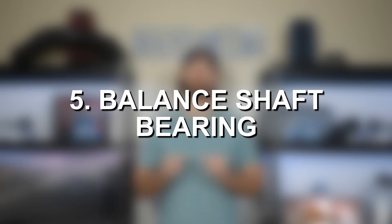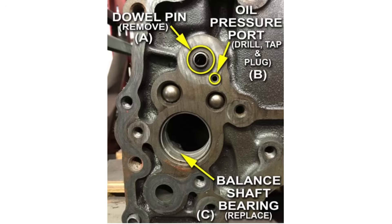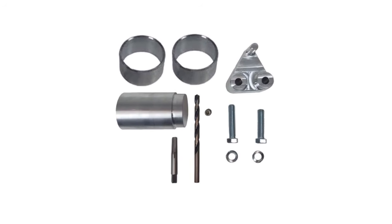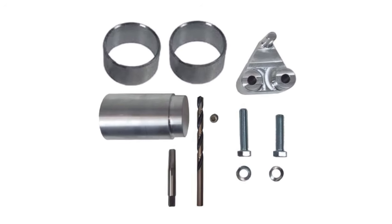As a bonus item, we have balance shaft bearing failure. This is a bonus because it predominantly affected Venezuelan models of the 3RZ-FE sold from 2001 onwards. The 3RZ-FE uses two chain-driven balance shafts to help reduce engine vibration. There was a manufacturing defect with the Venezuelan engines; this didn't affect the U.S. market, but balance shaft bearing issues can still occur. There are companies that sell balance shaft delete kits, which is a common way of ensuring the balance shaft and its bearings never become a problem.